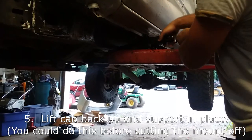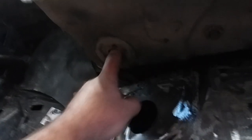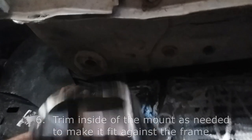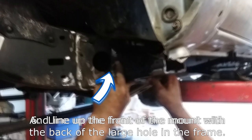It's not much. To fix that, I'm going to put a factory jack right here, lifting the cab up. Now the body is not sitting on the frame anymore. We're test fitting this, and here's what we come up with — the cab has some extra steel up here. You can see where the mount originally went, and this extra steel is located right here. So instead of putting this all the way back, we're going to keep it on this extra plate of steel, because that's obviously there for a reason to support the cab. So we're going to move it back to about here. This is going to give us way more room than trimming the mount ever could have, because the entire spot where that mount was is now exposed. You could probably fit a 42-inch tire with this.